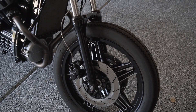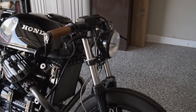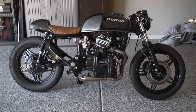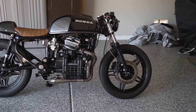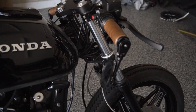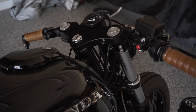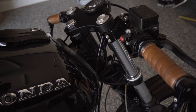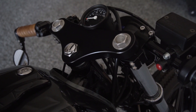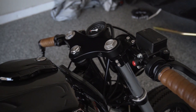Some of the things we had to do to get this front end to work was have the fork tubes cut down — about an inch and three quarters, if memory serves — to get the overall stance I wanted. The front forks are a little bit too long for this cafe look, so I sent the forks off to a company in Illinois called Frank's Forks. They cut the tubes down and then re-tapped them. I also used a steering head bearing conversion by All Balls Racing and had Cognito Moto make this custom billet triple tree clamp, which is just a little bit cleaner looking than the stock GL650 triple tree clamp.